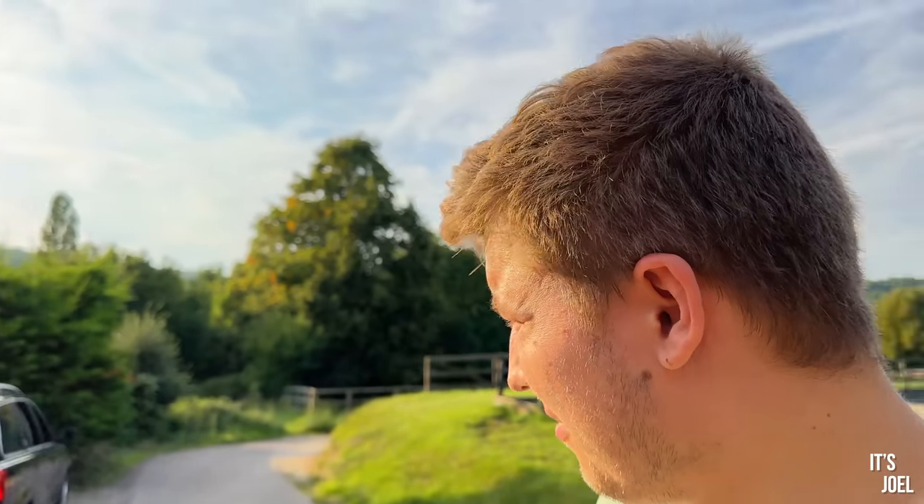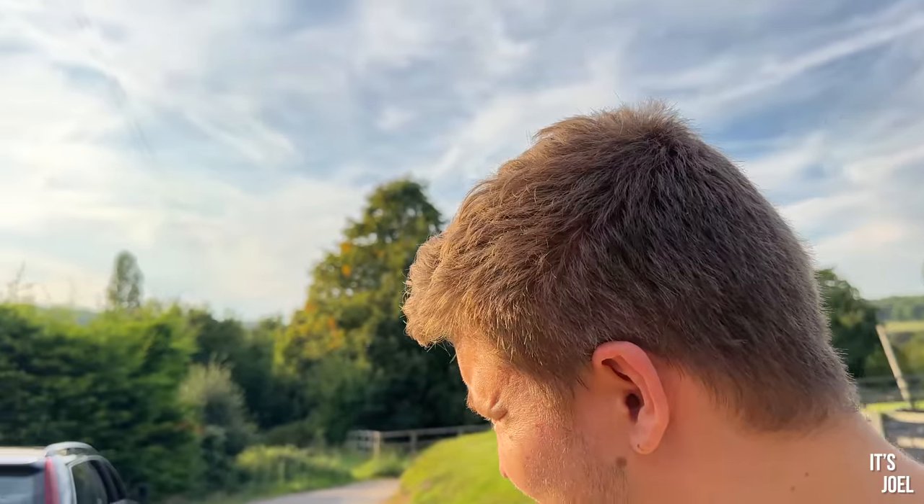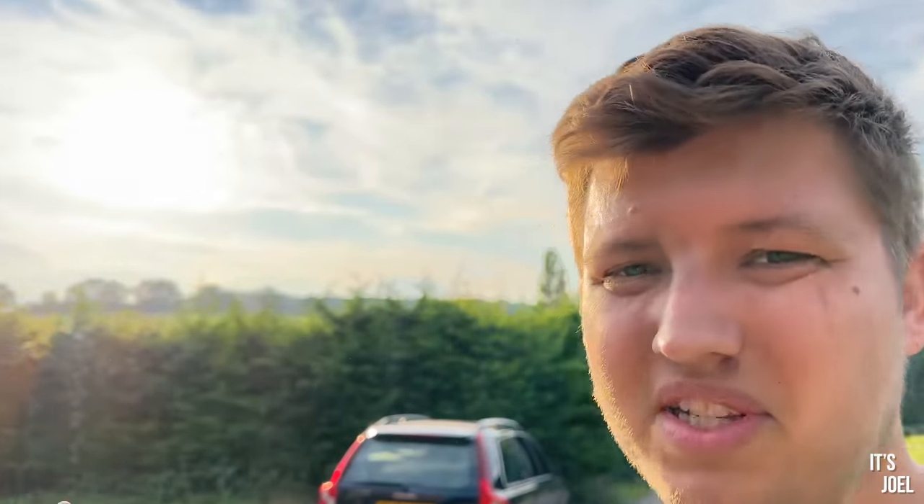That's the end of a very educational week for me. I've just taken the car around a few runs on this private estate and nothing's fallen off. I've rechecked the lug nuts and they're all still torqued up to spec. It seems to be a little bit better on the tracking, but I'm sure that's to do with the new wheels being balanced differently, and also the new control arm. In terms of the MOT, it's going to fail if I took it there right now because the ABS light is still on. I'm going to try and get a copy of VIDA in the next couple of days before it goes for its MOT and get that cleared.